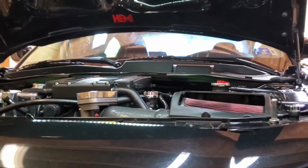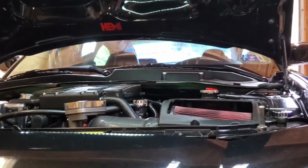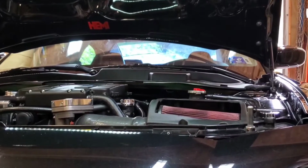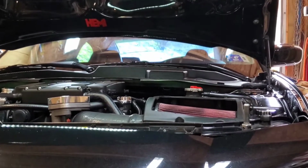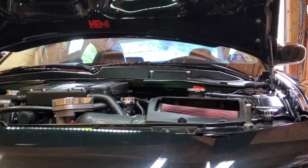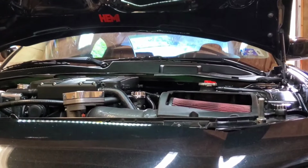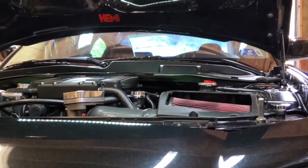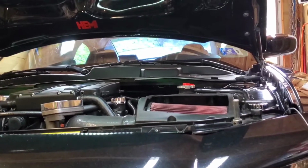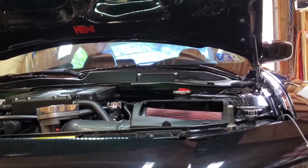And what that usually shows is, when you go from a big change, just for instance, say you've got a 4-inch pulley and you go down to a 2.75 and you only gain 20 horsepower and 80 torque, that shows you there is a flow restriction, that the blower is out of steam. So that's what we've seen.